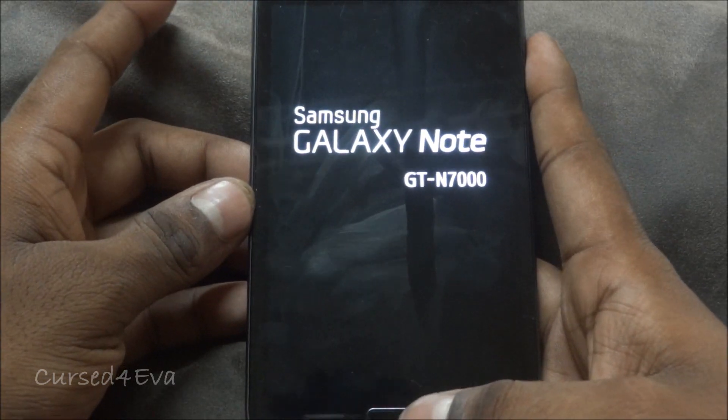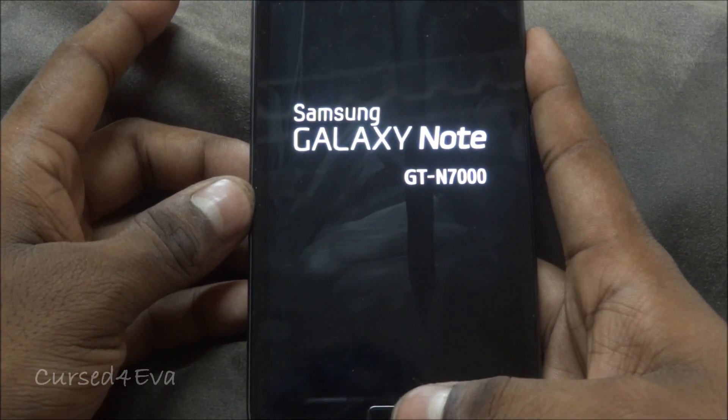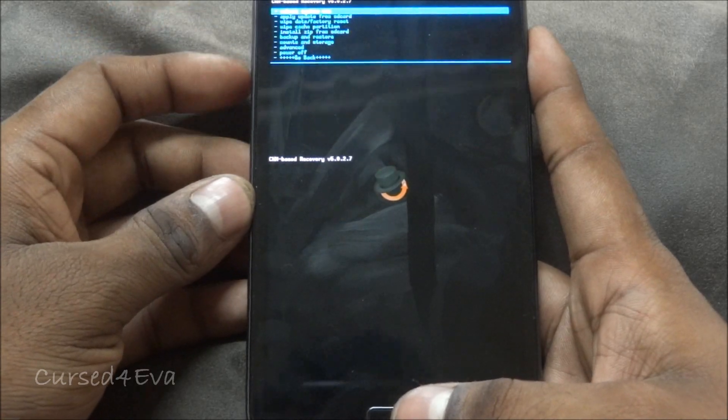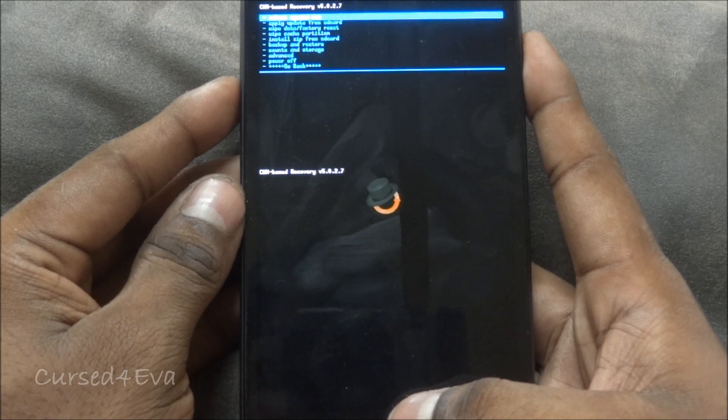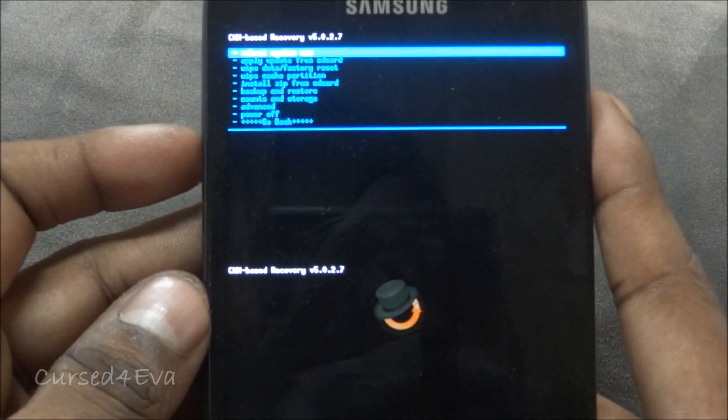You can let them go once you see Samsung Galaxy Note displayed — this should reboot you back into recovery. Before you do this, make sure you use Titanium Backup to back up all your settings and apps, because we need to wipe.